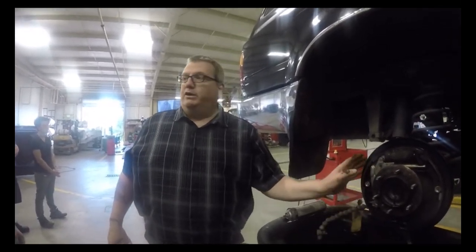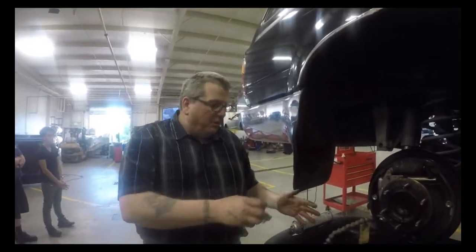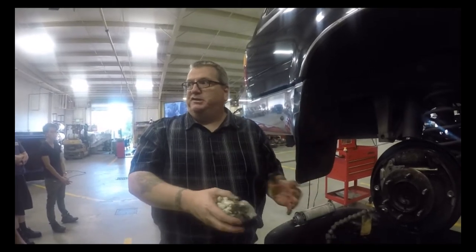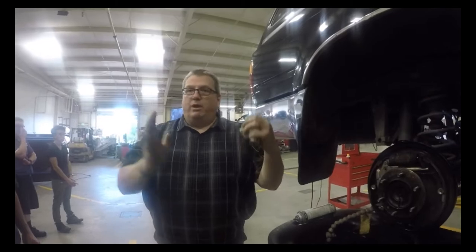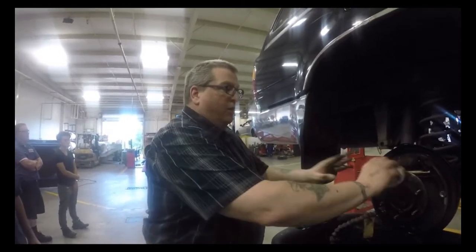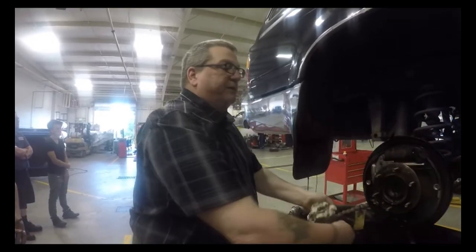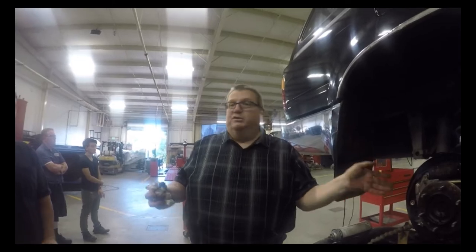One of the tricks I always did with shoes, because there's so much material, you almost can't work on them without touching the shoes, is I would take a piece of masking tape and put it across each shoe. That way, if my hands get on there and I get it dirty, I'm getting the tape dirty. And then when I get all my springs on and I'm ready to go, I just peel the tape off and the shoe is undamaged.